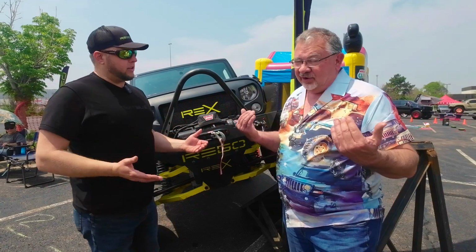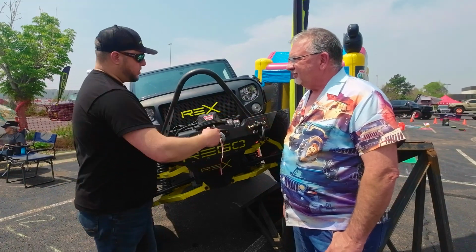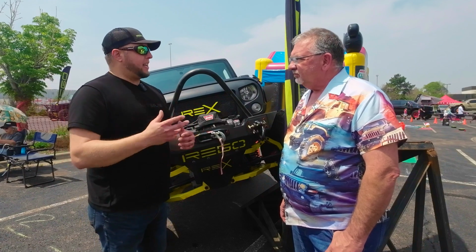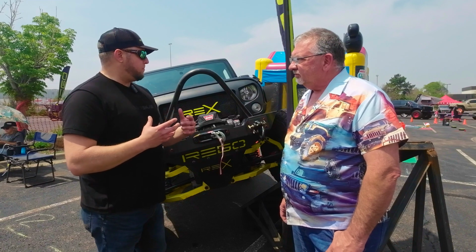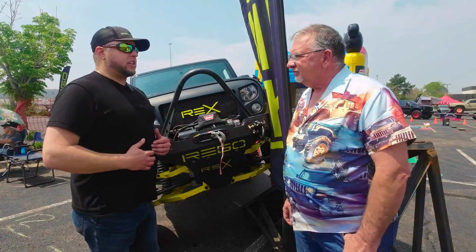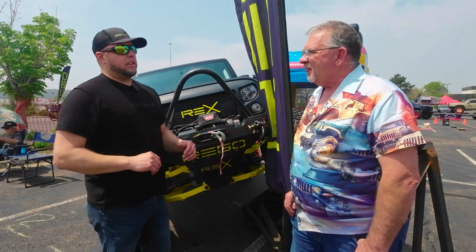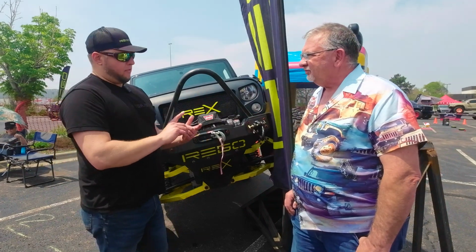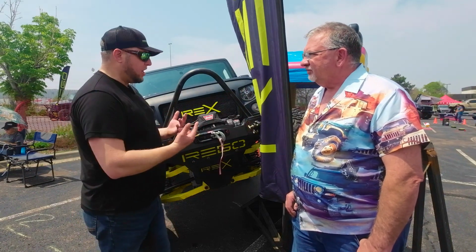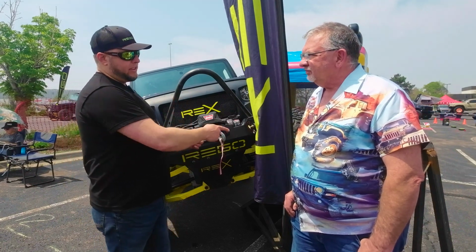And if you're going to upgrade, you're going to... Right. So you've got RCVs to begin with. So we start with the best. We get a new long shaft, and it just stubs right into there. We build that kit so it's really... you could do it in your garage, right? I mean, most people could do a Dana 60 in their garage too. A little cutting, a little welding, right? Same thing. But this is for the guy that wants to go faster, not slower, right? And you can run 37s, as you can see, and everything clears and tucks perfectly with this kit on both a 4-door and this 2-door.